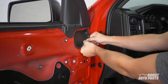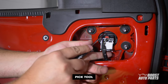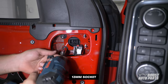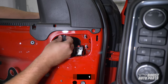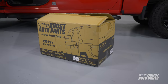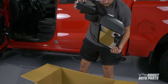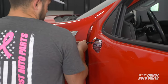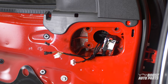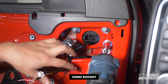To replace the mirrors, first remove the grommet. Then disconnect the mirror connector by first pulling on the red tab, then press down on the black tab to pull the connector out. Remove the four 13mm nuts holding the mirror in place. Be sure to support the mirror from the other side. Fully remove your factory small mirrors from the truck. Next, unbox your Boost Auto Parts tow mirrors. Guide your brand new tow mirror onto the mount, making sure not to pinch any wires in the process. Supporting the mirror from the other side, install the four 13mm nuts to secure the mirror in place.